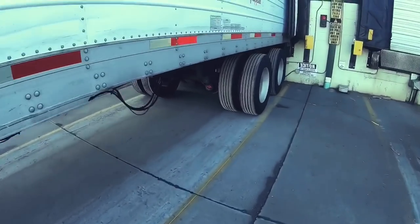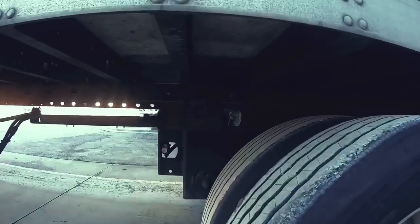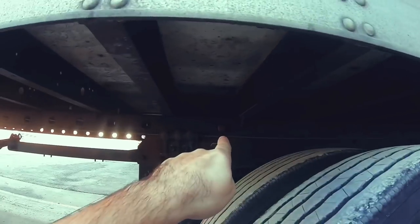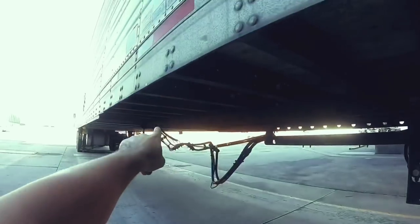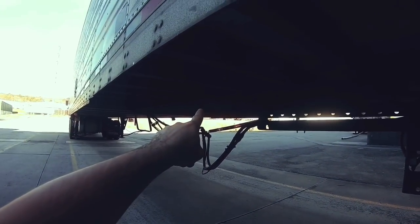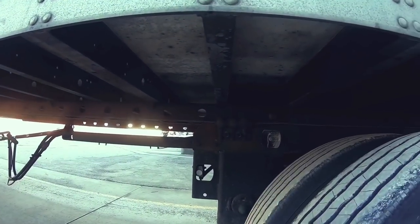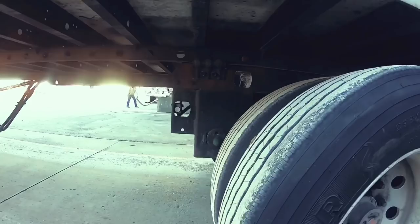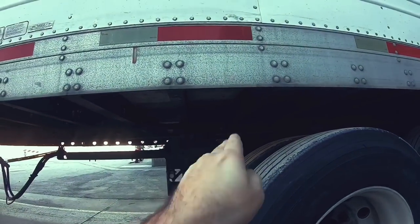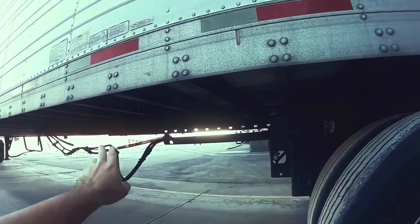Here's your trailer, and as you can see here are the pins — they jump right out. There's one right there and one right here. I go by this pin here first. Usually when I'm over 40,000 pounds I'll go between hole number six and hole number eight — that's kind of a sweet spot for this trailer for me to be balanced out. How it works is you lock your brakes, pull this out, and the pins will jump right in, then you slide the trailer.